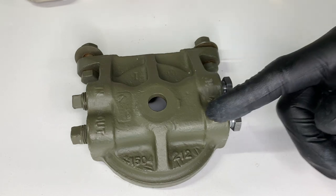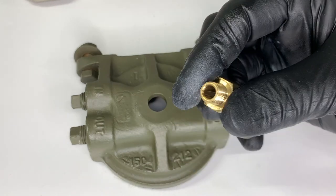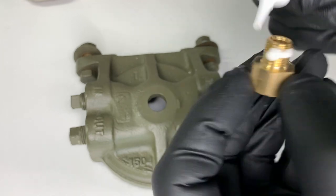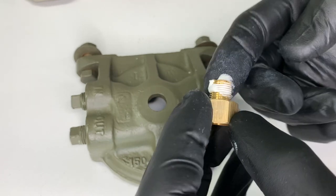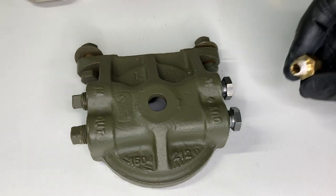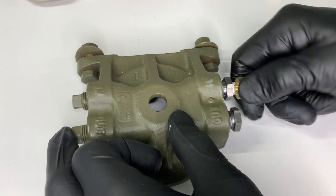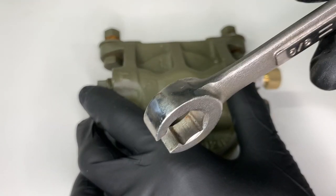We've got our two reducing bushings set in — one on the outside marked 'out' on top of the cap, and one on the inside. Make sure you can differentiate between those two. Next I'm going to install the connector — the 5/16 inverted flare tube connector — and again I'll use the sealant on the threads. Some folks don't like to use sealant on threads; I've had very good luck with it over the years on not only Jeeps but different automobiles. An ounce of prevention is worth a pound of cure. Threads are all coated the same way as the reducers, and I'll spin it in by hand.